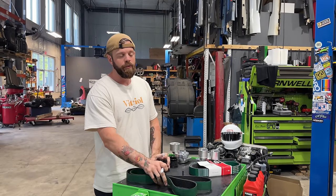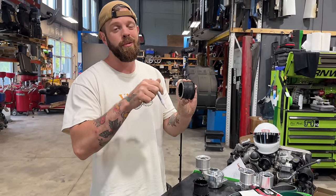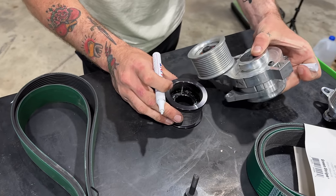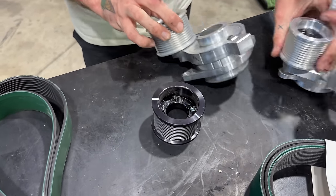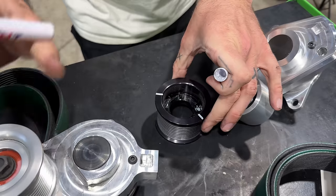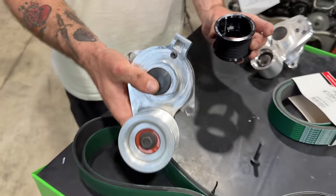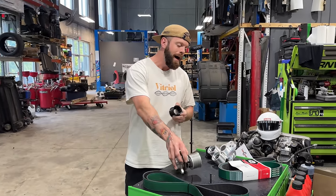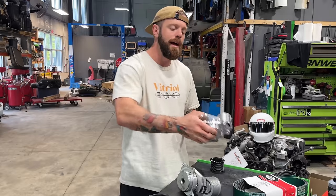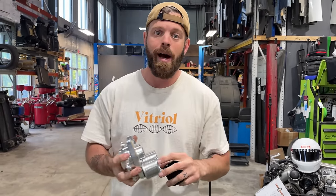The LS9 is notorious for belt slip. Even with this massive 11-ribbed belt, it doesn't contact the pulley enough once you start downsizing. With this tensioner, the belt wraps from there to there. With this one here, we're going to pick up an additional 55 degrees and put it to about there. Could we have run this tensioner with the old pulley? Yes, I don't think it would have been a big issue, but while we're in there — which is of course the famous last words — why not install this? If we can reduce belt slip by even a small amount, it's going to let us make more power.